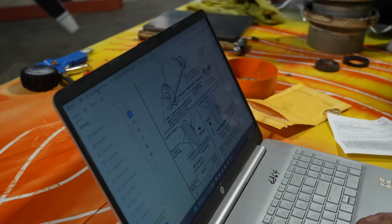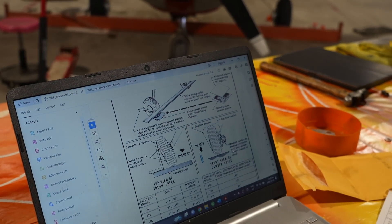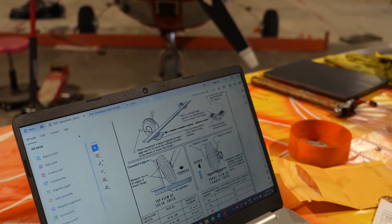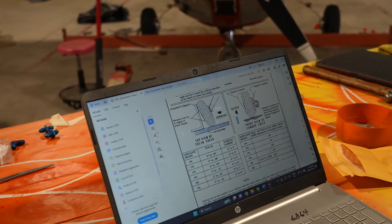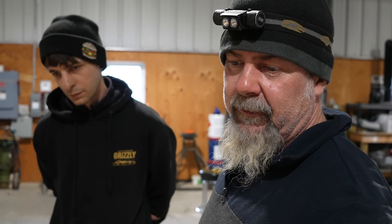There are our wash plates. I left my carpenter's square at home so I measured the angle on the back side instead. Toe-in on a 172 is allowed zero to 60 thou. Our camber is okay, but our toe-in is a little excessive — we're allowed zero to 60 thou and we're now at about 120 to 160. So we're going to have to go in and change our shims a little bit to fix that.